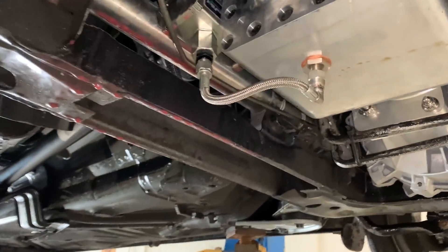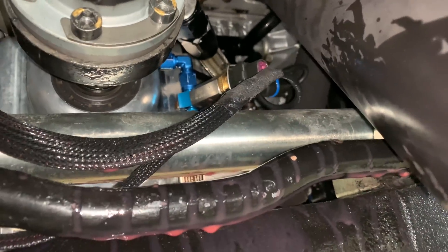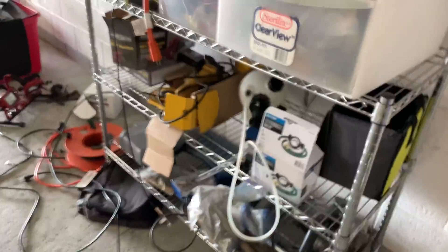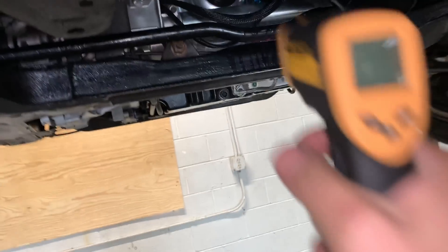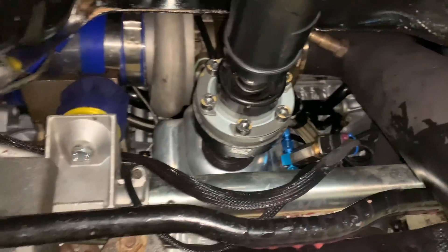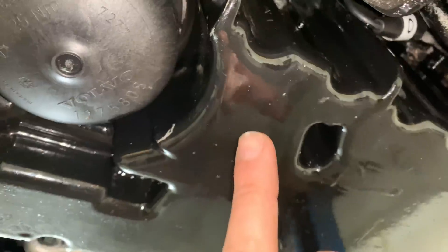She sprung a leak — looks like it's leaking from the pump. I thought maybe the front seal popped out but I don't see that. There's something going on with the pump. It's still got plenty of fluid in it so I didn't run it dry. Let me check the temp — it's not that hot, showing 120 on the computer, so I don't think we did any damage. Probably a good time for a fluid change anyway — it's been 120 miles.